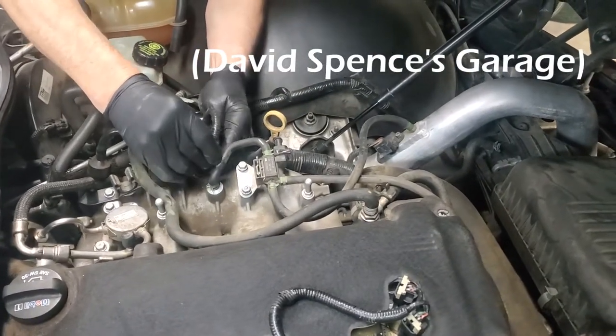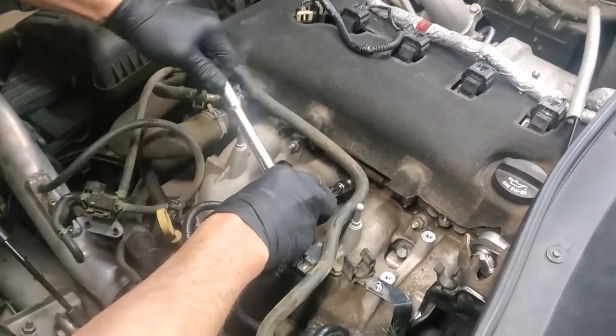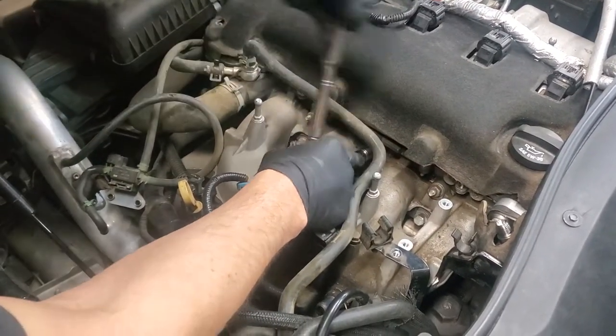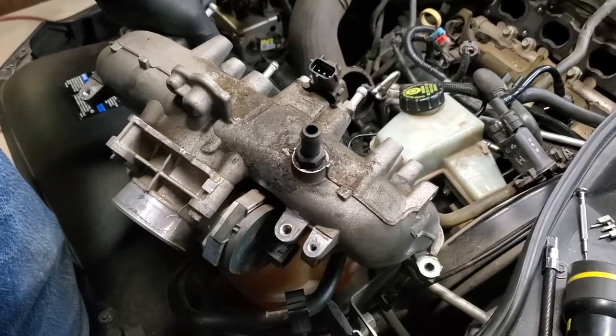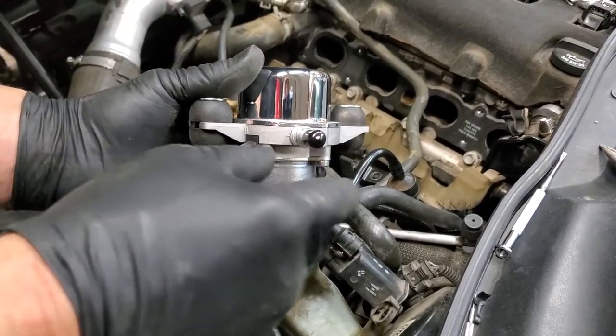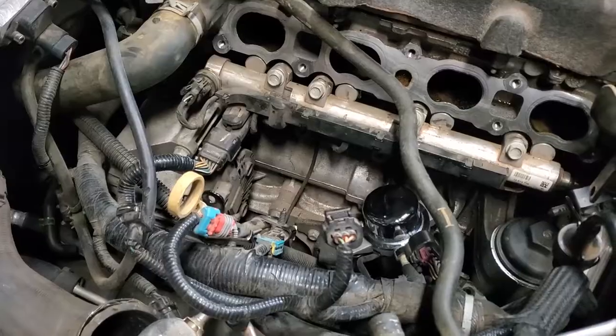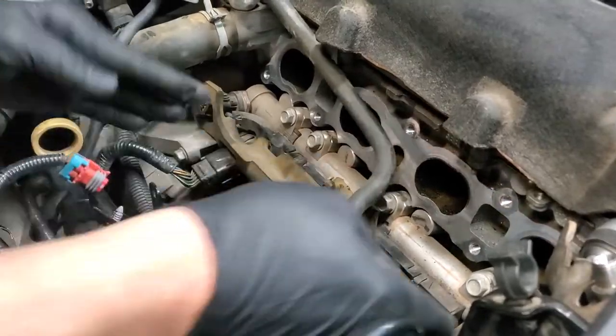The brakes on our 2007 Pontiac Solstice weren't as responsive as they should have been after a cold start. That didn't mean that the car was unsafe to drive, but the brakes would only degrade over time. We used our diagnostic tool and got the code P258B, which indicates that the power brake booster vacuum pump isn't performing as well as it should.